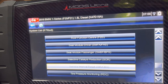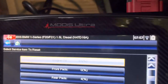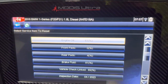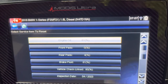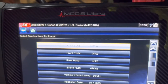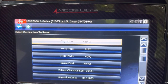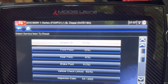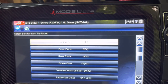It's collecting data. When you go into this menu you can see: engine oil 61%, front brake pad 0%. Visually I said the same. Rear brake pad — it has a bit more life — it's 4% left. If you have a computer like this, it also tells you what you need to do. Basically you need to change front brake pads, and rear brake pads have 4% left. Because of that, I'm going to do both front and rear brake pads.